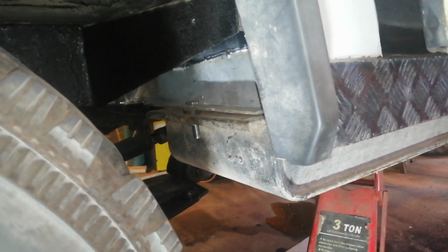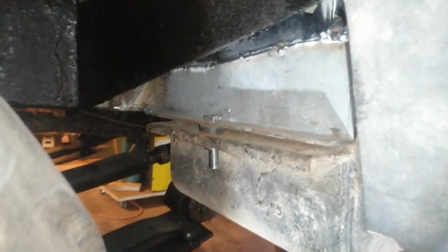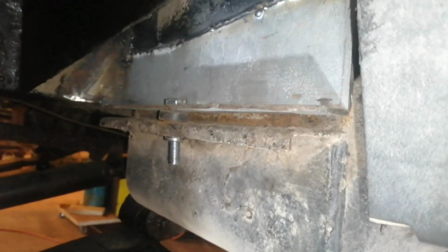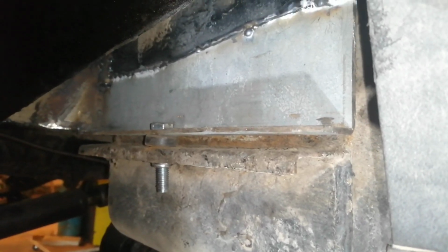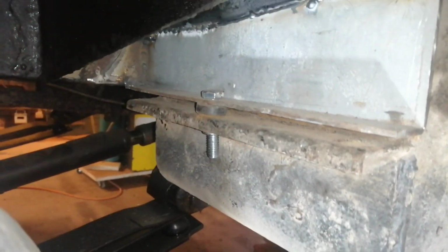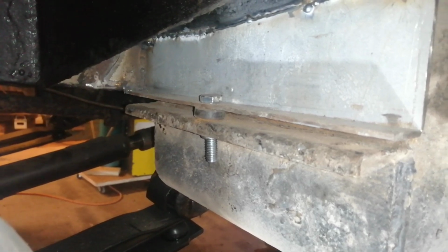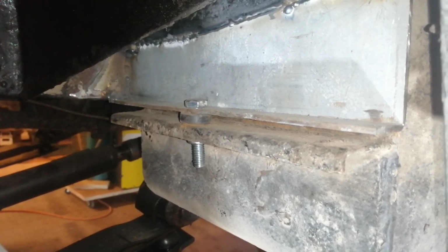So while Alex has been repairing the other side, I've paid a little bit of attention to the petrol tank this side. You may remember there was a nasty hole there. Well, I've just replaced it with a bit of the thick steel that Alex has brought with her, which is ideal. Perfect sort of gauge. See the rubber washer in there holding the petrol tank up. I held the petrol tank up in place and then drilled the hole, put the nut and bolt through, and that's all tidy. And the front end is where the new outrigger has gone.